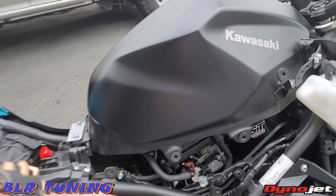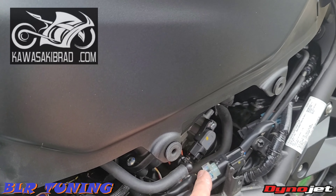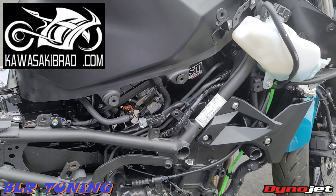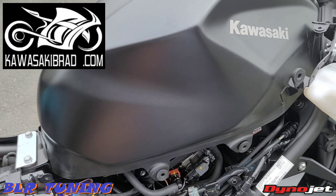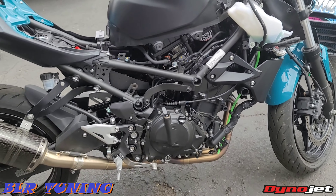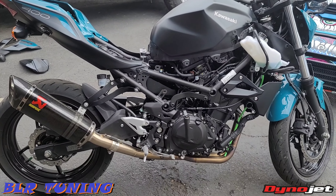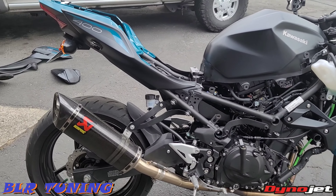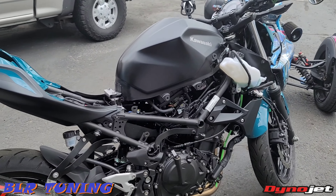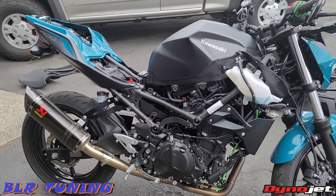There'll be a link in the description below for my video on this, and there is also a link to purchase — this is from Kawasaki Brad, and this is his O2 sensor delete kit. So if you want to run the full spectrum of tuning in Power Commander 5, you can just do this delete kit and then your tune can be from 0 to 100% RPM and throttle position in Power Commander 5. If not, then you're going to have to tune only the open loop section and use the green wire for the O2 sensor signal input wire. So let's get this installed.